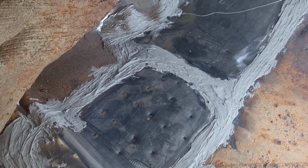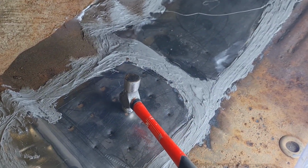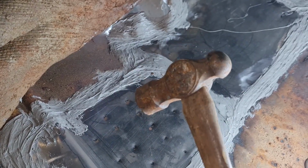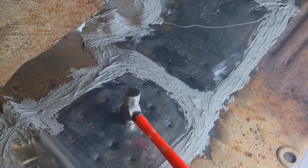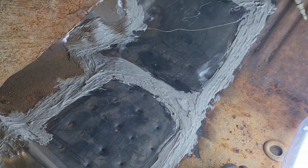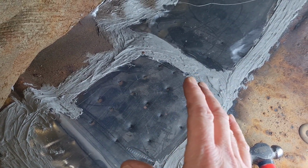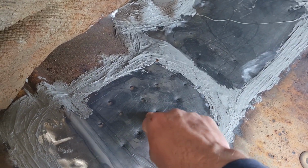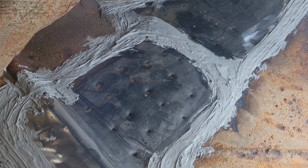What I've done is basically you get a ball peen hammer, sit it down, as you do, and then you get another BFH, and then you whack it hard, and that way you can keep that steel and you know where you're going to hit. And by putting these little dents in, it's taken out any excess metal, if you like. I won't say it stretched it, but anything that's loose, there's now no flex in that floor, but there was before I done this. It's basically bead rolling without bead rolling.